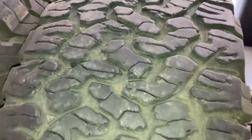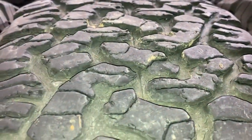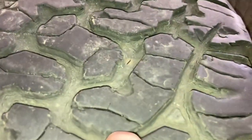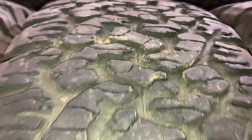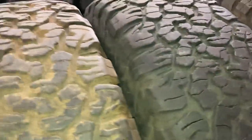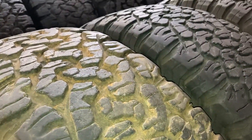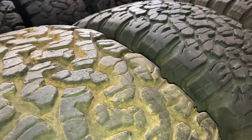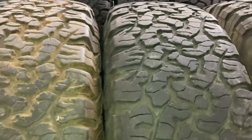Anyway, there you go guys, there's a bit of info. That'd be a reason why the BFGs are rubbish in the wet — like any other tyres that wore like this as well. How much tread's actually left there to get any traction out of those blocks? This is reasonable — you can see a reasonable block there. Hopefully that's helped you with why the tyres may or may not be getting traction. If you use them off-road, they're going to end up looking like this — put your centre diff locks on. BFGs are a rip-off; there's plenty of better tyres that are cheaper that'll suit most people's needs. But if you like BFGs, go use BFGs — we've still got them on our vehicles, but when they wear down we're going to be looking at other tyres. Thanks for watching, subscribe, turn the bell on — that's another KO2 video. See ya!